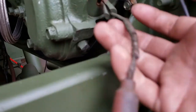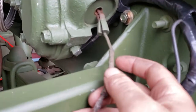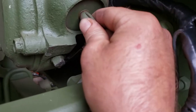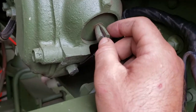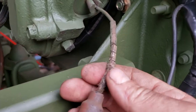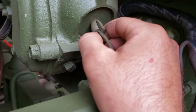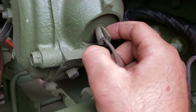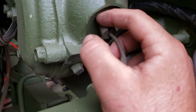This is of course your horn wire. This is going to get replaced; I just haven't gotten around to it yet. It just sits in here with this little rubber split plug. It's a good idea if you still have this — if it hasn't fallen off yet — to go ahead and glue it in. If your wire is rotten, replace it while you can, before you glue this in preferably. Because if this falls out and your horn shorts on that, it rubs through since this is metal, and then your horn goes off constantly.